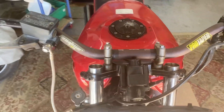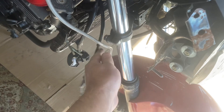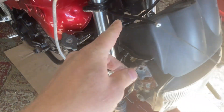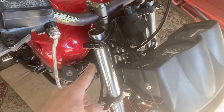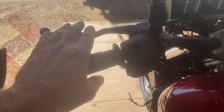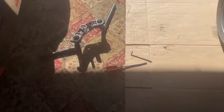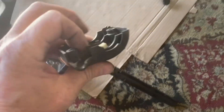I'm running into some issues I already kind of knew were coming. The brake line I had to reroute — brought it up underneath through here, so I'm going to need to make a bracket or get a clamp to secure it. Rerouting the throttle cables too — they were going up and over the fork tube and I'll have to put them behind that. But we've got the bars on and the clutch handle on. If you've ever swapped factory bars for aftermarket ones, your factory bars have holes that your throttle and control pods notch into.